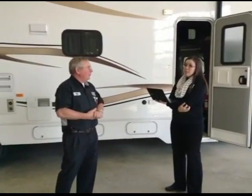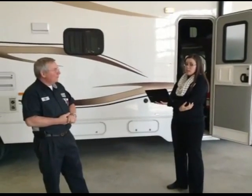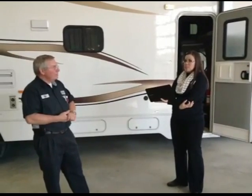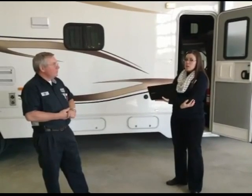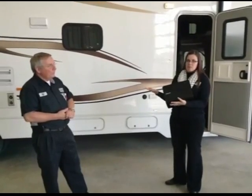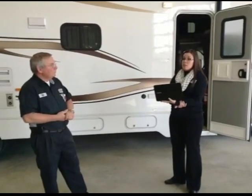Okay, how about another quick question? Should you start your generator and run it as you unwinterize? Well, actually, you should be doing it all the time. If you talk to the generator manufacturers, you will find some of them say you should run them for an hour. The majority of them say you should run them for 2 hours every month.